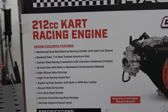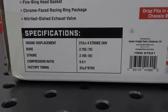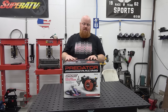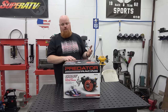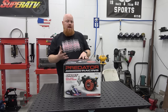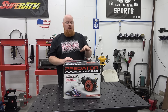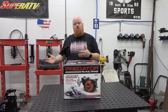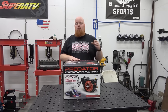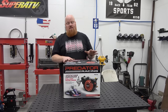Keep in mind if you buy this from the store you're going to need a few extra parts to actually use it. It does have a 70mm bore, 55mm stroke, eight and a half to one compression — about your standard specs for a 212cc engine. It's not like the 224 where we have a stroker set inside the block. This is basically a hotter cam and a 6,000 RPM governor set by the coil — digitally governed. So if you want to go with a 308 cam and rev to nine grand, you'll have to swap to a stock-style coil.